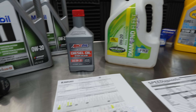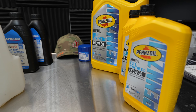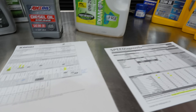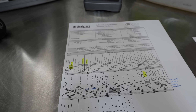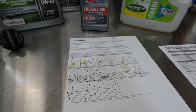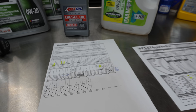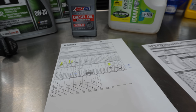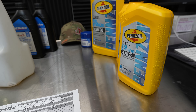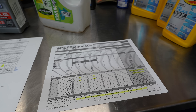That's why I felt comfortable running 5w30 in my truck. I will always recommend what the manufacturer tells you to run, but in my own personal use I am running 5w30. I did test the 0w20 first, got my results, saw some unhappy numbers, then went to the 5w30 and got some happy numbers. I'm going to do one more oil analysis — another 5,000 miles — to see what the Pennzoil is doing long-term.